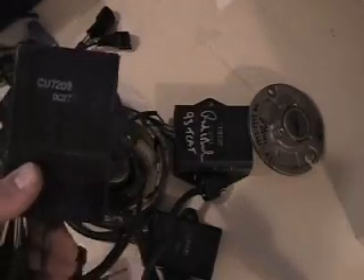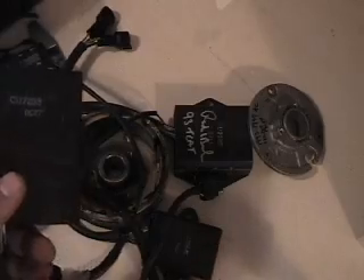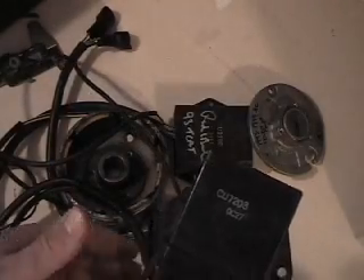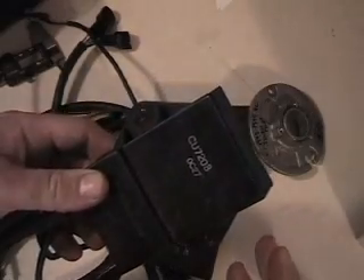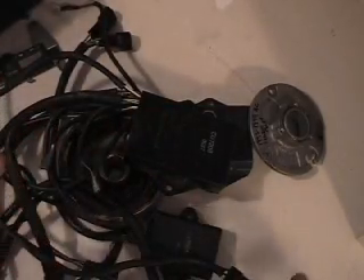In a nutshell: 2000 through 2002, you basically have to use that ignition complete. You can't swap out any parts — you can't put a 1995 stator in it, you can't put a 1997 flywheel on it. You have to use that entire ignition along with the carburetor TPS switch. You can use the older ignition on the 2000 to 2002 sleds — that's what I do. I use a complete 1993 ignition: the CDI box, the flywheel, the stator, and the flywheel mounting plate.